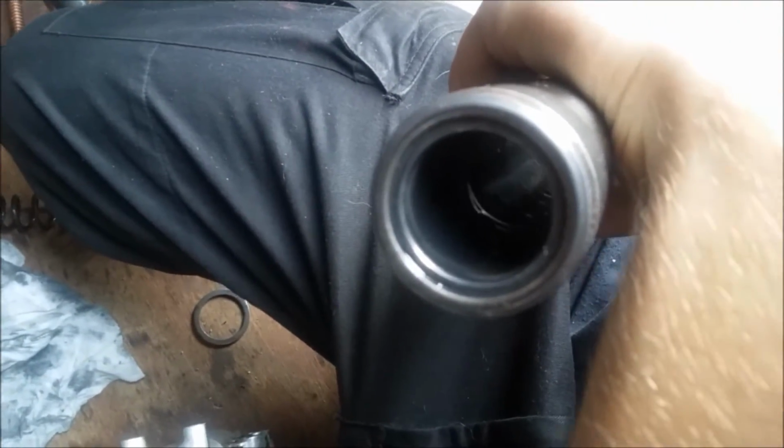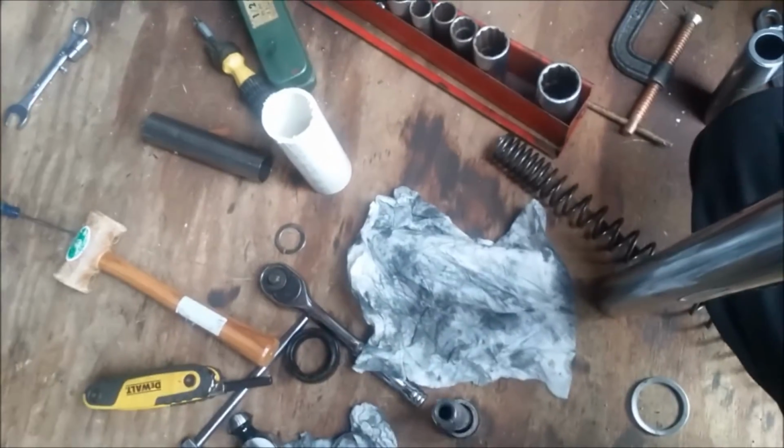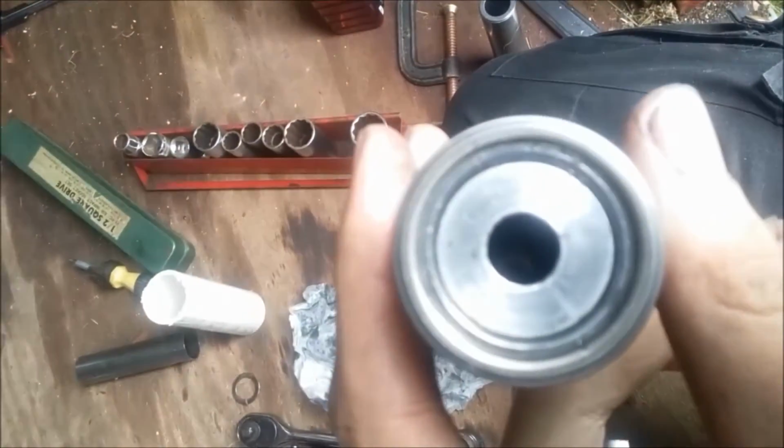So in the bottom here sits a channel. What we're going to want to do is match up with your damper assembly. There's this cap here. This cap is going to sit up in here, like so. You want to hold that because that's going to drop down in, well, this rod here into there. That's where your bolt's going to thread through when this goes back in through here. This is a stopper. So with that, tip this upside down like this. This end's going in. We'll have to set the phone down for a minute. Make sure you have your spring on the bottom, right there.